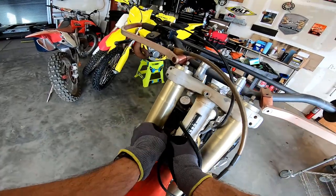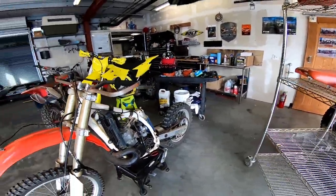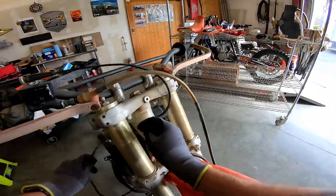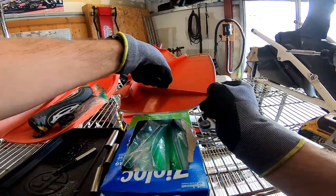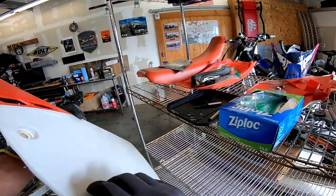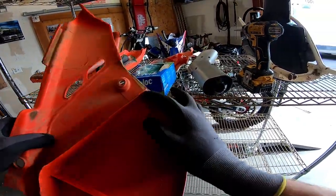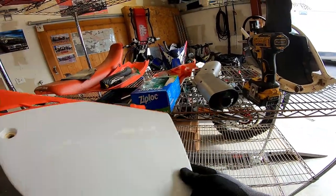On Hondas, these bikes do not run with these kill switches disconnected. If you're having a problem with the Honda starting or you don't have spark, this is one place to check. You would simply tie these wires together. However, then you have to stall the bike to turn it off, so as a safety feature just try and make it right. I was moving the tray and noticed something kind of interesting — maybe somebody can chime in in the comments. There's sort of this white paint that looks like somebody maybe actually painted it on. I was wondering if this was some sort of OEM piece but it kind of looks like maybe somebody did that themselves, like a mask job. Not bad — could have fooled me.